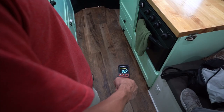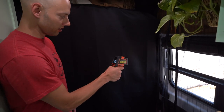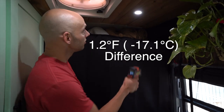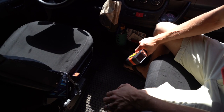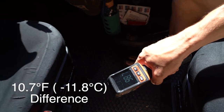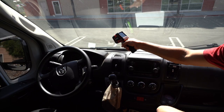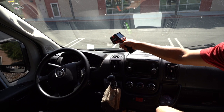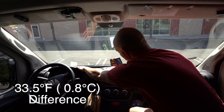It's been one hour and we're rechecking temperatures without the covers. In the cargo area: 89.4°, floor 91°, window 97.7°, ceiling 102.2°. In the cab it is super hot — floor: 98.6°, dashboard: 178°–180°, windshield: 134°. The dashboard is clearly the hottest spot. The difference with the covers on versus off is dramatic.